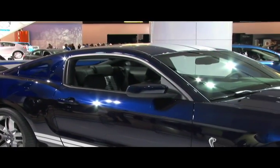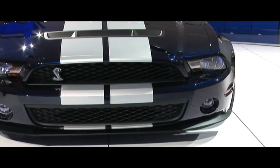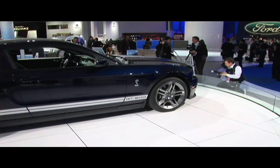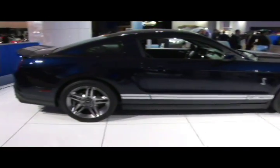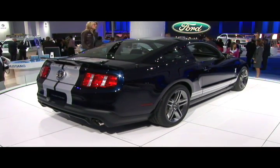Styling is still very aggressive. The changes relative to the regular Mustang are quite evident. There's a chin splitter in the front and a spoiler in the back with a gurney lip that combine to increase downforce in the front and reduce it a little bit at the back, for better front-to-back balance in the overall lift at high speed.